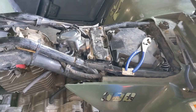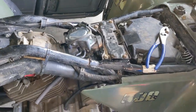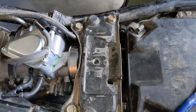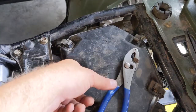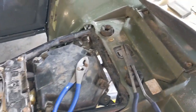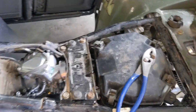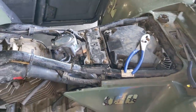I'm not done yet — now the fun begins of tuning it. It's just in there with all the stock 400 EX settings, so it's probably going to run like crap. I take the carb in and out six or seven times. After a few times, the boots will be used to it and it will go in a lot easier. Something to keep an eye out for is that you end up pushing the boot back some, so make sure where it goes on the airbox is sealed and not deforming the airbox. It helps to have the factory air filter cage with the bracket in the back. Those cages tend to rust out, so keep an eye on that cage and make sure the airbox is totally sealed after putting the bigger carburetor in.